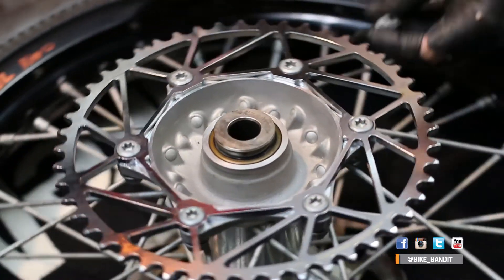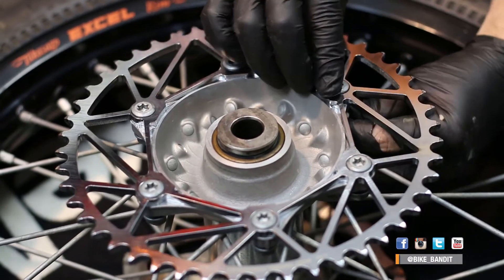You can use the wrench to get the surfaces mated up, then to really tighten them, do that via the nuts on the backside. No need to go crazy with the power here — recommended torque setting for my KTM is 25.8 foot-pounds. Tighten them in a crisscross manner.